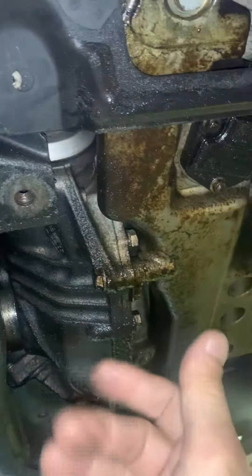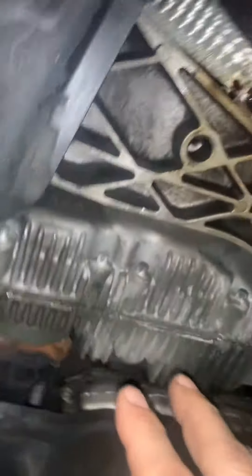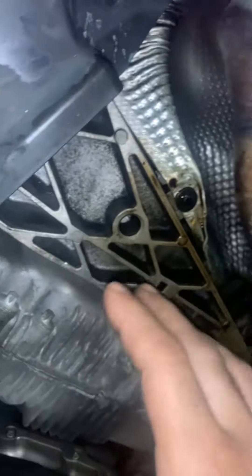Same thing here — remove the whole driveshaft. You're going to leave the differential; it's not going to do anything because it's not spinning anymore. If it's trash, then it's trash — that's fine. Just leave that hub. So you remove the axles, you remove the front driveshaft, and if there's a problem with the motor you don't even have to replace it — you just program the car as a non-four-wheel-drive car.